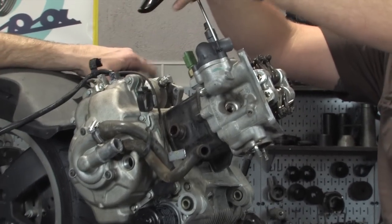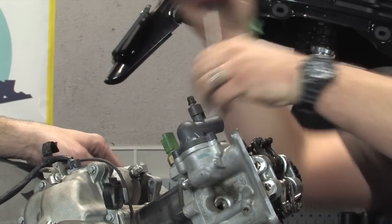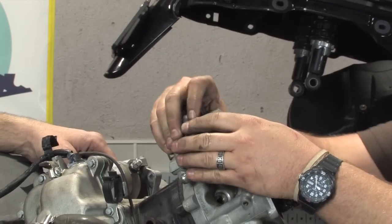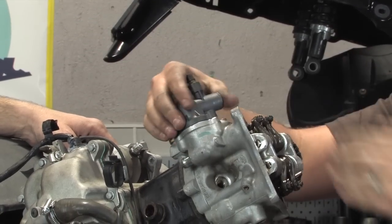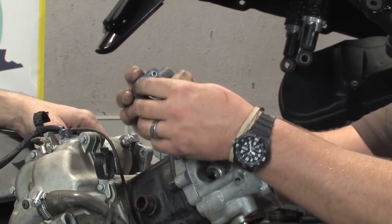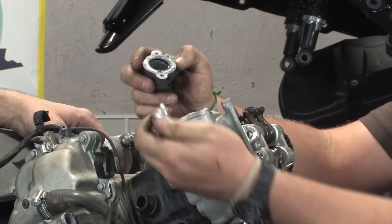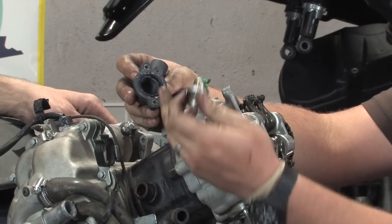Steve's gonna go ahead and take off the two accessories on the actual cylinder head that are gonna get reused on the new cylinder head. That's the thermostat housing. T25 wrench, take the two fasteners. Kind of pry it up gently. You notice the thermostat comes with it. Does it just pull out? Yeah, usually pulls right out. There it is. So you got the gasket, with the thermostat actually staying with it.